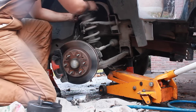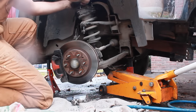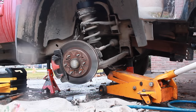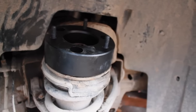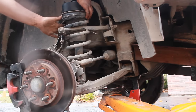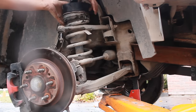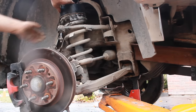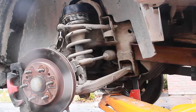I personally choose not to fully remove the strut. I find it easier to grab my spacer and install it while the strut is still in place — this way I'm not trying to fidget to get it out. Keep in mind that the spacer only fits one way. Once the spacer is installed, you're going to want to turn the full strut assembly 180 degrees so that the holes line up with the top of the frame and it lines up with the bottom where the strut bolts onto the lower control arm.